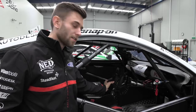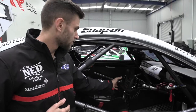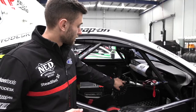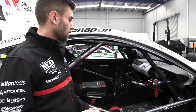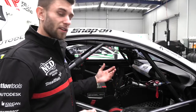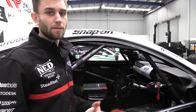Then obviously there are our normal shift lights and the dash that has everything. This is all customised to what we need, so everything we generally need when racing is on the wheel. Behind the wheel we have the brake bias — one is forward and one is rear. Sometimes we change it for different tracks; if there are a lot of high-speed corners followed by low-speed ones, we'll adjust it front or rear depending on what we need.